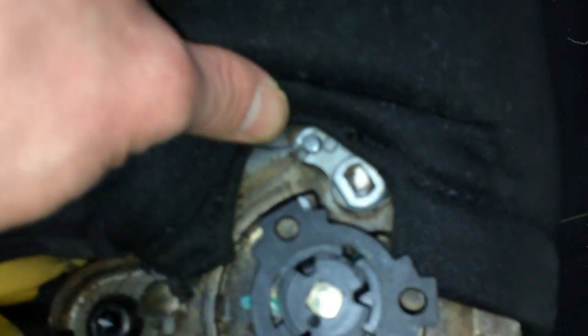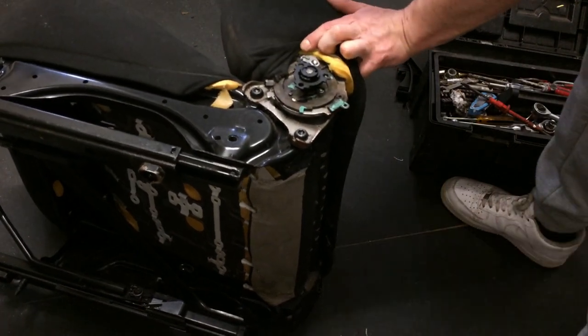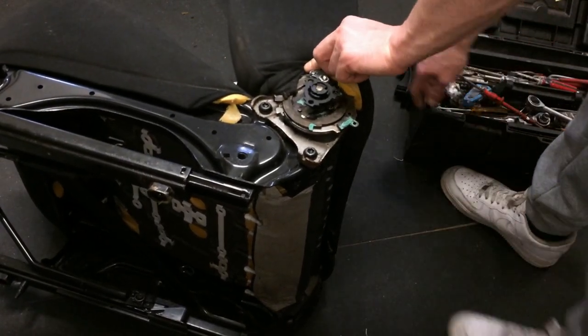For a new cable, send a small metal rod up through the seat so you don't damage the fabric — just to grab the end of the new cable and fish it through up to the point where the old cable was. Then simply pop the cable back into position, make sure it's seated correctly, and check you feel the resistance again when you operate the handle. It's now back in its slack mode at the handle end — just get the handle back on and I'll show you it working.